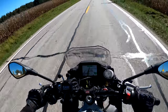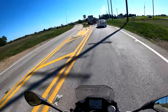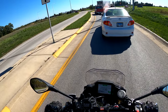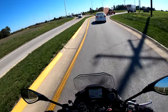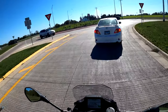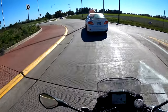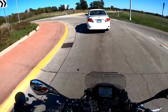We've got a roundabout here — let's rip through it. Being a V4, this bike definitely gets pretty toasty in traffic. Our temps right now are nice and cool at about 176 degrees Fahrenheit, but yesterday — even only around 70-degree weather — I saw temps of 223 degrees. These bikes do not like stop-and-go traffic or slow speeds. With a tune that kicks the fans on earlier it'll probably be better, but as it sits right now, she is a toasty girl.